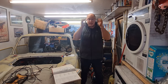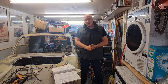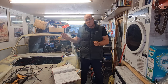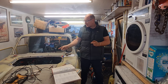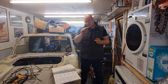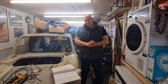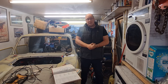That is where we're going to have to leave it on yet another cliffhanger. The van once again has thrown us another curve ball with no oil pressure. We didn't do much more after that because we need to sort that out urgently. I've done a couple of little tests - there's a spring and ball bearing just underneath the oil filter like a shut-off valve, and that is all intact. I took the fitting right off the side where the oil pressure sensor was, turned it over, and it's just very slightly trickling out. So there's definitely something wrong and we're going to have to get the sump back off again.